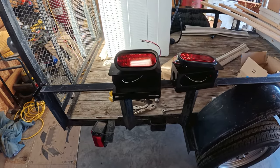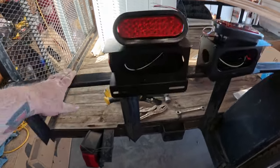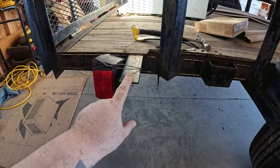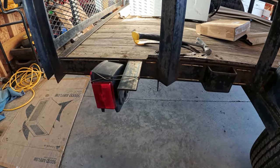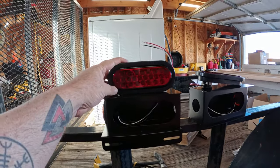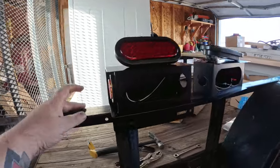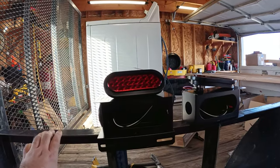So part of making it tough means putting something on that's not going to allow the light to get bashed around. So these are steel light boxes that I got, linked down in the description, so that we can bolt them to this angle iron piece right here and then not have lights that are going to get destroyed. And another nice thing, these are like lights that you would find for like a semi or like a flatbed or something. So if I have to and I'm in a pinch, I hit a truck stop, new lights. So we got amber indicators on the side there, red for the turns and brakes.